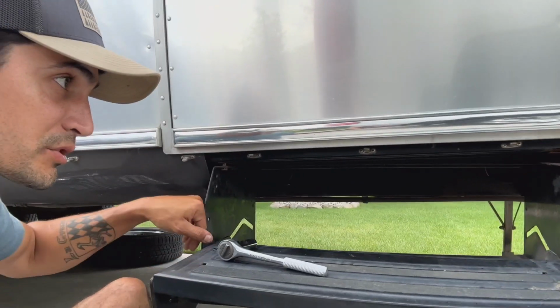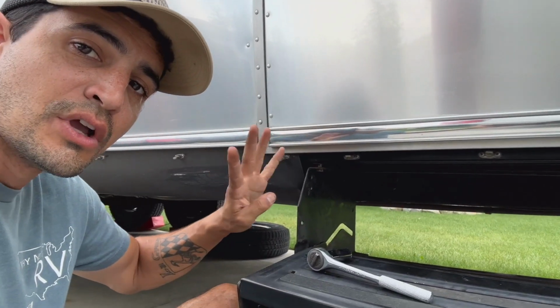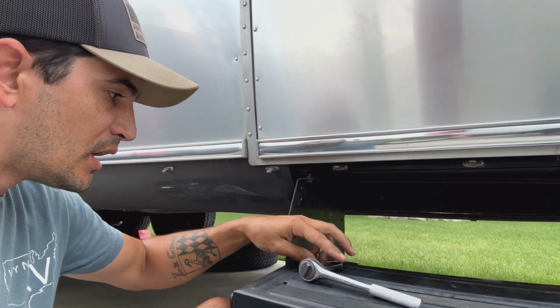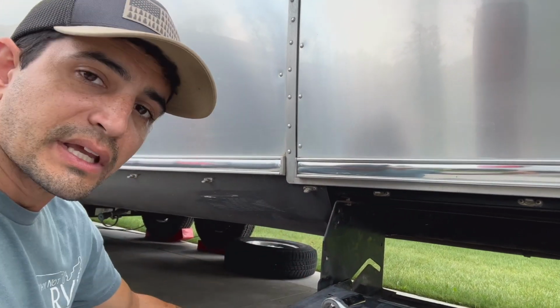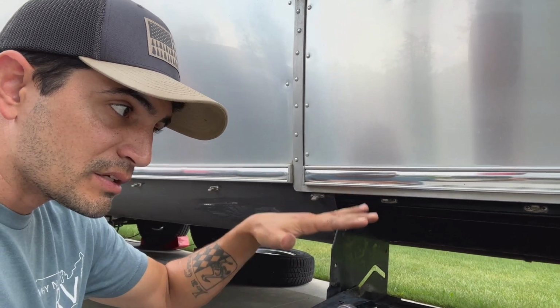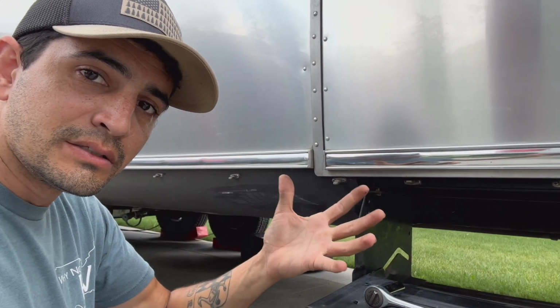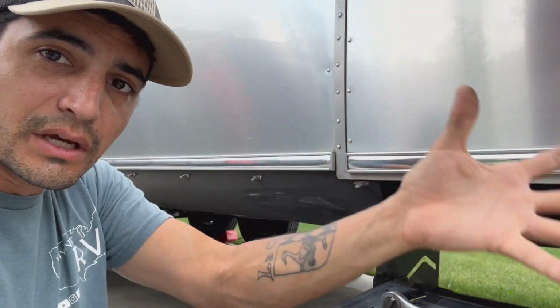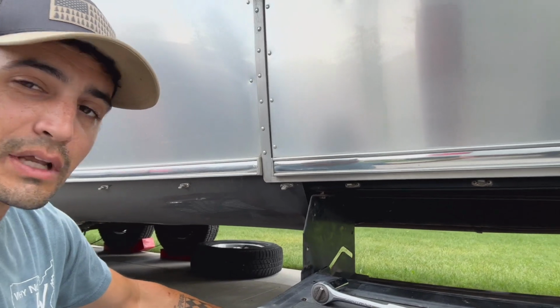So I got a couple of bolts removed. I only got 2 left in 2 opposite corners, but that is all that this is, just those 4 bolts in the 4 corners. On this particular Airstream, this is a 14mm wrench to get these bolts off, and then the stairs are gonna drop out. Obviously, this is probably a 2-man job because these last 2 bolts, once one comes off, it's gonna be uneven. So you kind of keep pressure up and, you know, get the stairs down gently without damaging anything else.